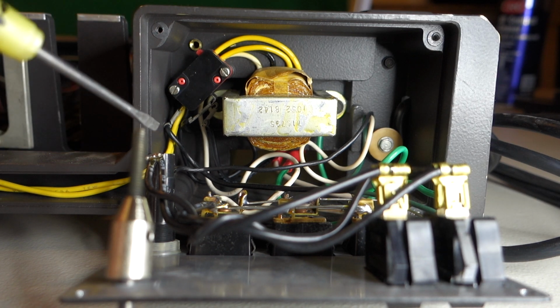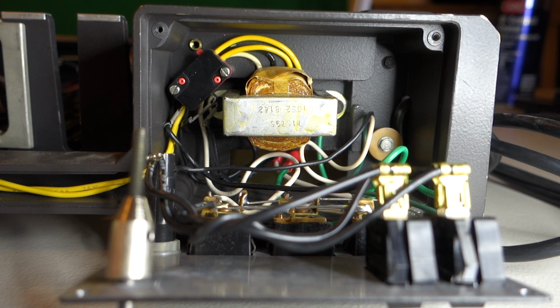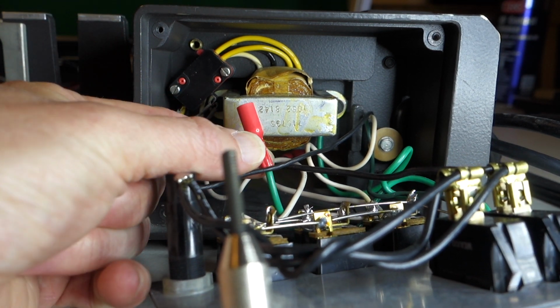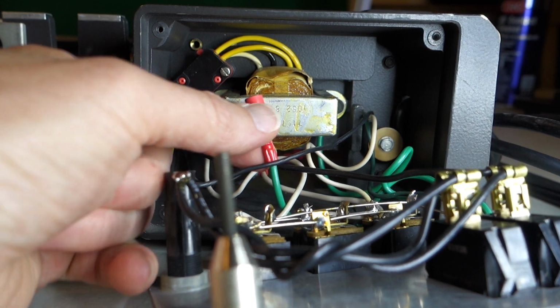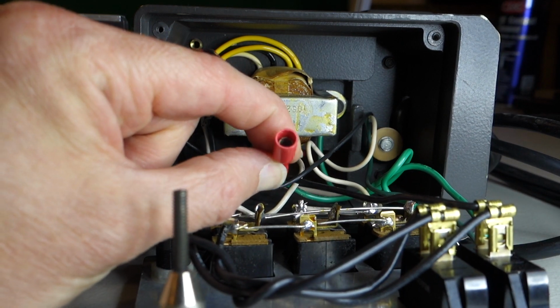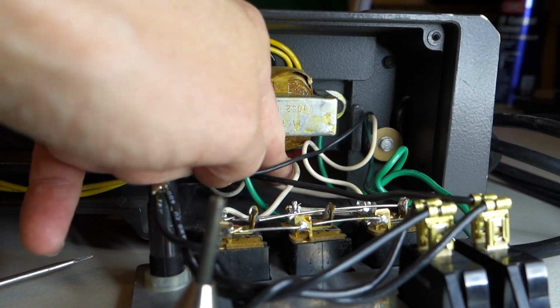There's also a transformer in here, which is carrying power over to the left-hand side of the backpack, and it's probably like a 12-volt transformer or something like that. I'm just guessing though, and it maybe is used to power the speakers on the left-hand side. I can't get the left-hand side open though, so I can't tell for sure. And then finally we have the wires that plug into the AC input on the power supply on the Apple II. And so here, for example, we've got the green ground wire, and these are just terminals that just plug straight into the plugs on the AC input.